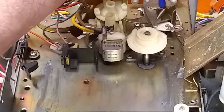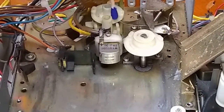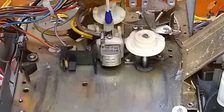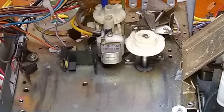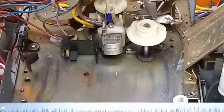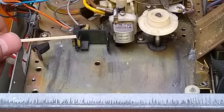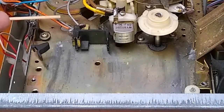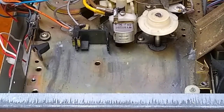There's the solenoid. Most players have some type of a setup like this with a solenoid that hits this plastic wheel. The plastic wheel is attached to this, and wherever it hits on this wheel determines if the head goes up or down. So when the foil hits this, it temporarily connects these two terminals so power gets from this wire into this wire, activates the solenoid, and there you go.